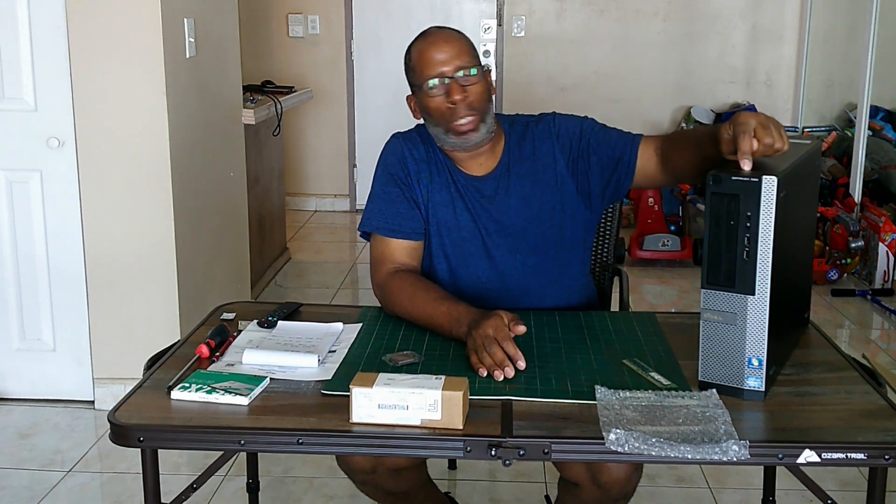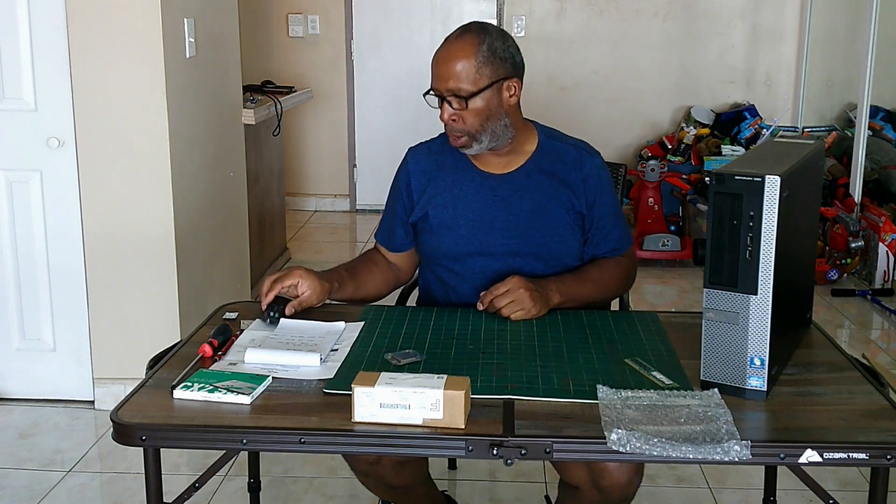You can use Windows 10 on this system. Even though it says you can't, all the USB ports in the back work — you just have to update your BIOS by going to the Dell website and entering the service tag located on the system. Some of y'all peel them off, and then you have to go into the BIOS as you boot up. Enough talking — let's go ahead with these upgrades.